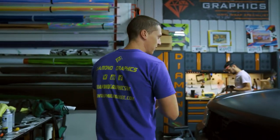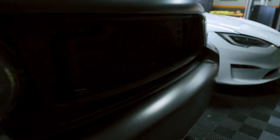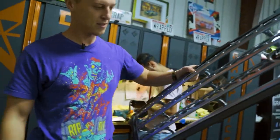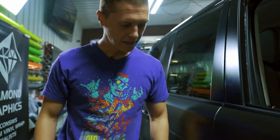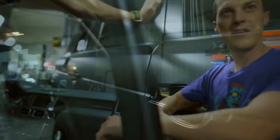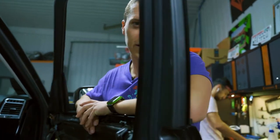That was the most surprising thing on the Range Rover. We're doing it satin black and we're buying a new gloss black grill — this is the old one. We also have gloss black side vents going in and we're going to be tinting the taillights as well. With the newer Range Rovers, the door handle just pops off with a screw, but on this one we have to do full disassembly of the door and then disassembly again of the door handle itself, which took a little bit longer than we thought.